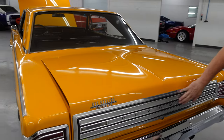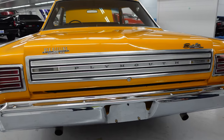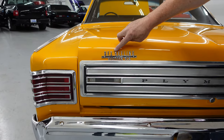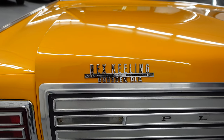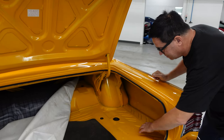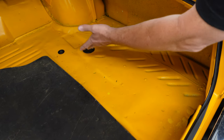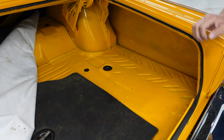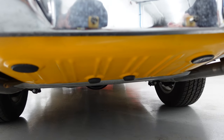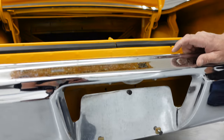At the back of the car, the trim panel for the Satellite is correct and in really nice condition — these are often dinged and showing signs of trouble. The tail light lenses and frames show not too much pitting. One thing I think is likely original to this car: a dealer sticker from Rex Keeling, Gadsden, Alabama. I'm going to bet this is an Alabama car — dry and rust-free. The trunk is in nice condition; the original trunk floor appears to be present and accounted for, not a reproduction. It has the rubber drain vents, and the camera going low shows the yellow body paint extends to the underside of the car including the floor — often full of rot and holes, but not here on this very likely Alabama-sourced car.